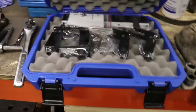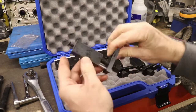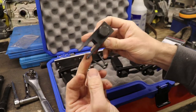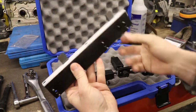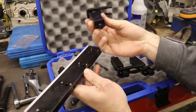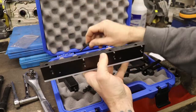Let's see what you get for $1,200 — let's unwrap this thing. You get four of these compressor pieces, which are not badly made — they've got a nice little guide pin. These attach to a backing bar. This is what goes over your valve between the spring and compresses that spring. There's also a soft plastic piece to prevent marring the engine, and some dowel pins to help align onto the back. Four bolts attach this tool down onto the engine, going into four slots in the back.